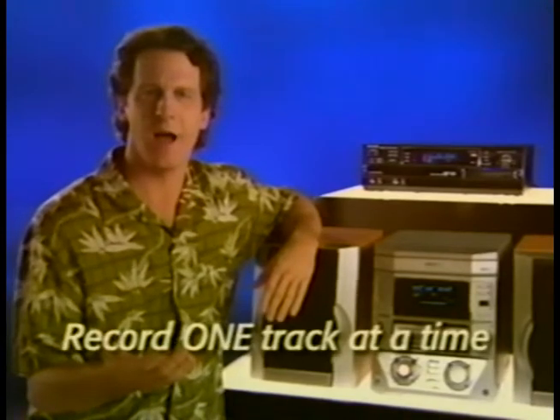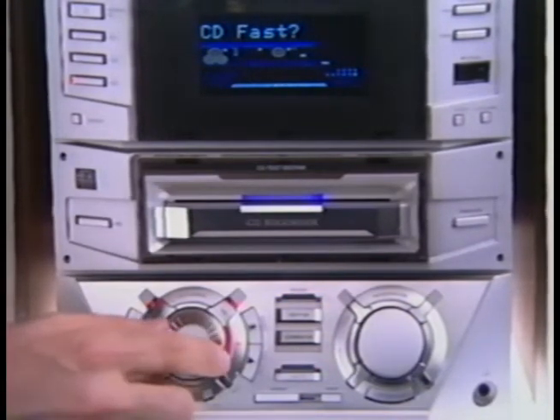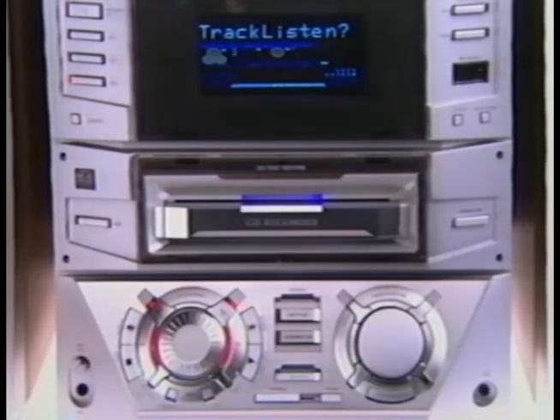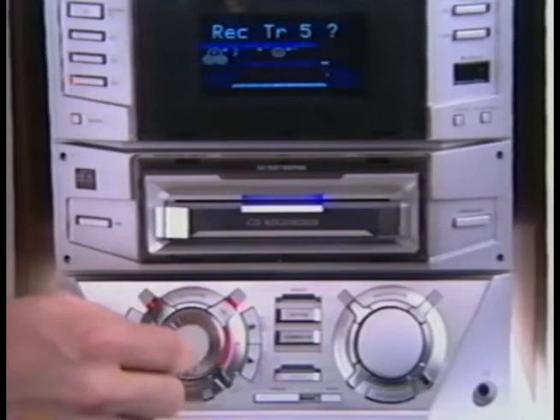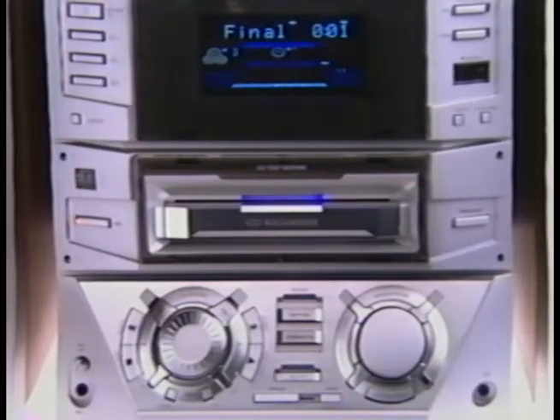Maybe you want to lay down one track at a time but not all at once — that's when you use the Record Type button. Press the button for the CD you want to copy, then press Record Type. Turn the Jog Control knob to 'track fast' to record at double speed, or 'track listen' to listen while recording at normal speed. Press Yes to confirm, then turn the Jog Control knob to the track you want and hit Yes again to start recording. You can keep adding tracks the same way, immediately or later. Once you've burned in all the tracks you want, you've got to finalize! Push the Finalize button and press Yes to confirm. In about two minutes, you've got a CD ready to work in virtually any CD player.